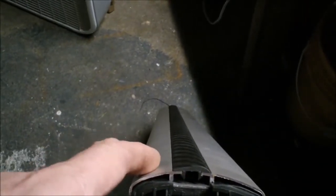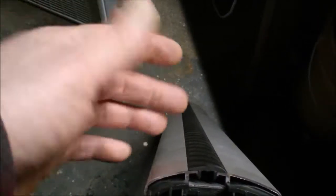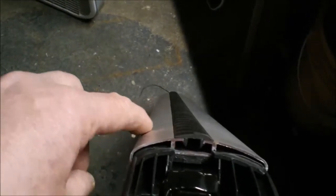To tell what side it is — from what I can get from all the pictures — you'll see this center strip here, which may or may not come pre-installed in yours. Everything I've seen, they don't come pre-installed, but this one did, which is another reason I believe these were used before I got them. The shorter end goes forward, and the pin here — which I'll show you out in the car — goes on the trailing edge on the wide side. That's how you'll know you have the right side; whichever side the pin is on will be going towards the back door, and this end is towards the front windshield.